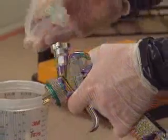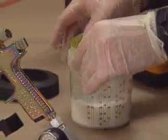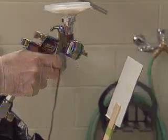Two: for mixing color in the cup, attach the lid to the gun. Add some 2-inch masking tape to the top of the liner. Pour some of the mix into the lid. Do a spray test and retint as needed.